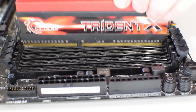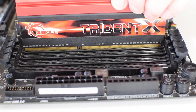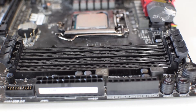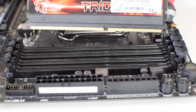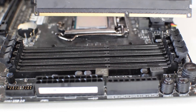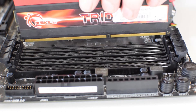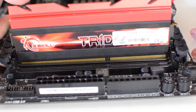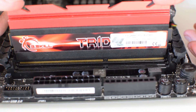If you try to install it the wrong way it will just not fit — it will stop because that bridge doesn't have anywhere to fill in. So the RAM itself needs to go in one specific way, with that cutout matching the bridge on the slot on the board. Once you've got those matching, pop the RAM into slot number three just to show you.